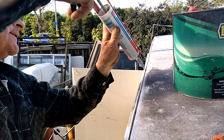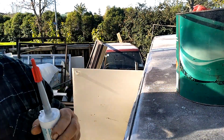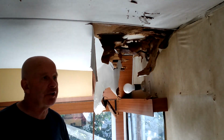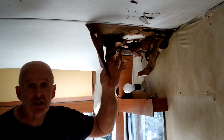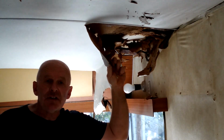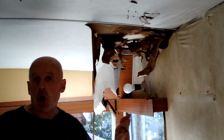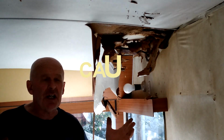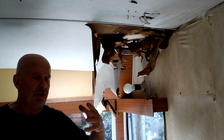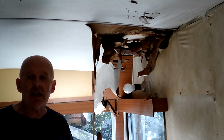and it's really good how it bonds to the aluminium and the old caulk that's down inside this crack. I'm very impressed with it. When you start pulling out the cabinetry and working on the inside of it, this is the kind of stuff you're going to find. Back in the 1970s, they didn't have silicone and good quality sealants like we have today. All they had back then was caulk. And caulk appears to be something made out of chalk and snot. And honestly, UV and weather and the heat and the cold and everything that a caravan is subject to over the years can't be handled by caulk.